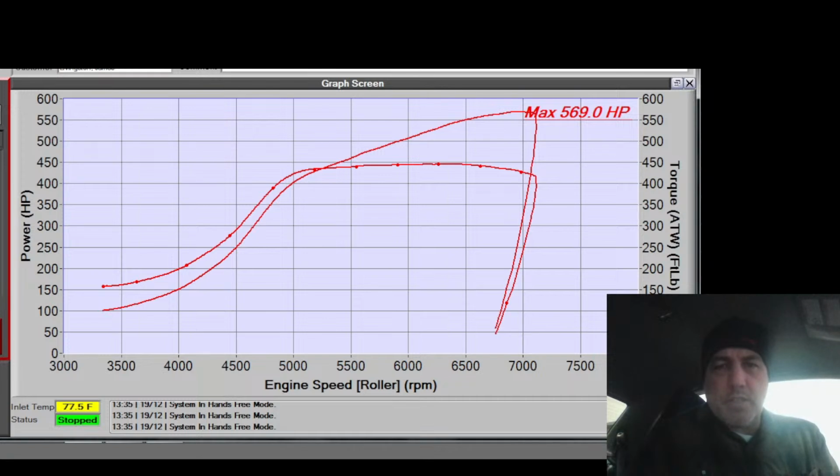This is 1300s, yeah. But this is where they're done. At this level right here, they're probably at 100% IDC on this dyno. I don't have IDC logged, unfortunately. Fuel pressure stayed up, though, so I'm impressed with that. That's good news. Fuel pressure stayed up the whole time.